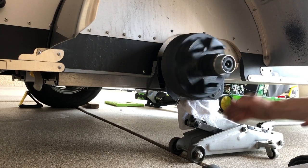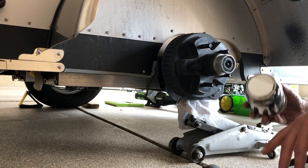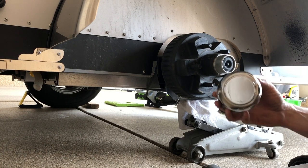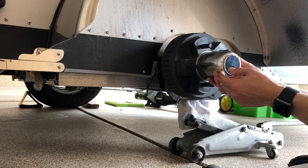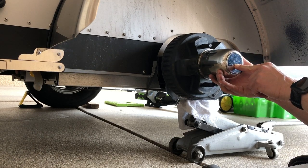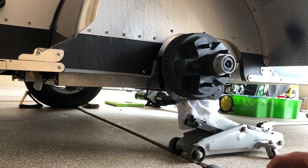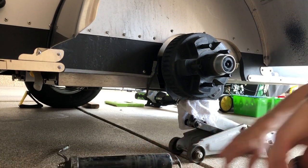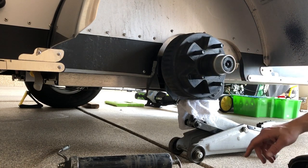If you think about how many times that goes around, even on your car, it's amazing. You do not have to take the wheel off to do this — you have a little cover here that you can just pop off with a screwdriver or a butter knife, and you can get access to that grease zerk through there. I took off the wheel in this situation because I needed to put a new tire on the trailer for other reasons. So let's go ahead and mount the tire back on.